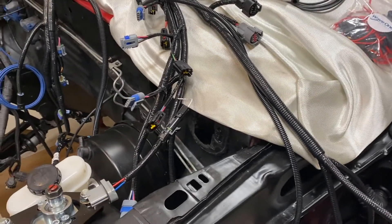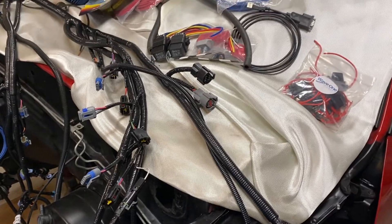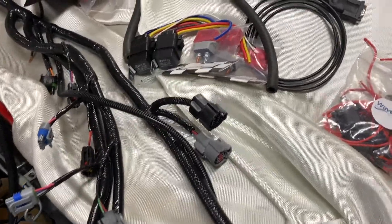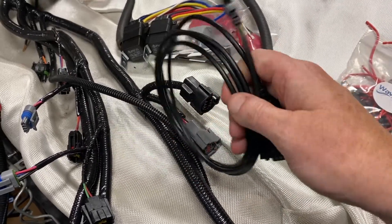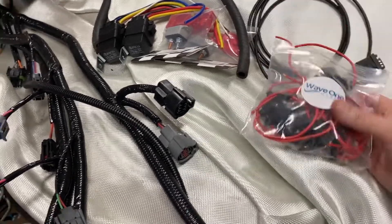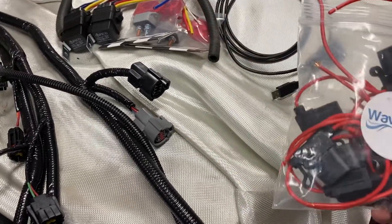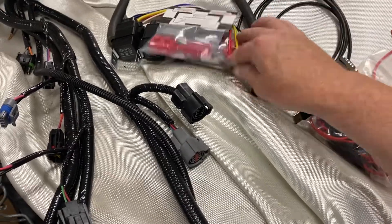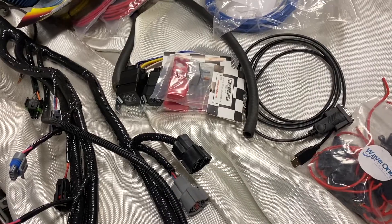Some of the things you're going to need when sourcing this out: if you're really modified, you'll need a USB to RS-232 or USB to serial to go from your laptop to program and set up your Innovate wide bands. You'll need some 5-amp fuses for things like traction control and boost control. Obviously you need a couple of relays, some breakers to the fans, a breaker for the methanol control, switches, and some 16- to 8-gauge wire in different sizes. But not a whole lot outside the system do you really need.